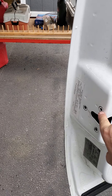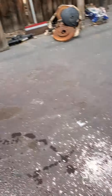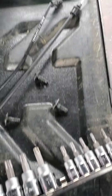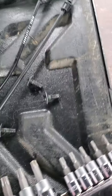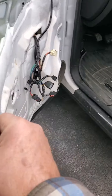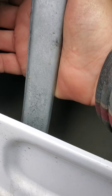There's three bolts that hold this latch on. They're T30 star bits. You take those three bolts out, and then you have to take off this panel, get it loose, get it up out of your way. And that gives you enough room to put your hand in here and pull this thing out far enough to do what you need to do.